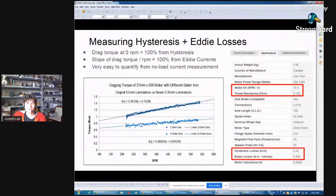One of the nice things about the motor parameters — the drag torque from hysteresis and eddy currents — is that they can actually be measured very easily by looking at the motor's drag torque as a function of RPM. If you just take the motor, spin it, and measure the torque on the axle shaft while increasing speed, the torque at zero RPM — where the curve intersects zero — is all from hysteresis, allowing you to quantify the hysteresis torque directly.